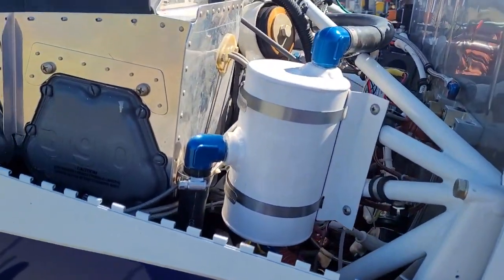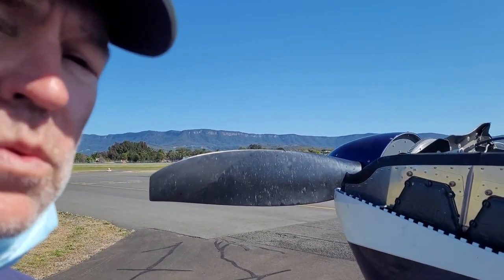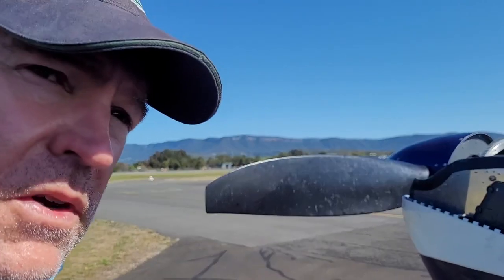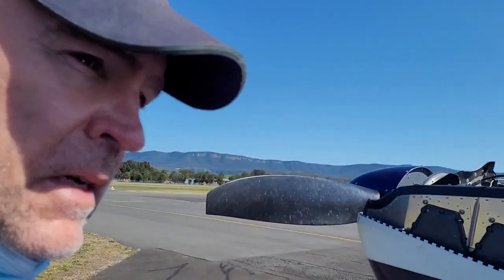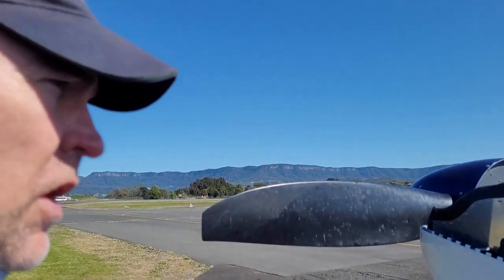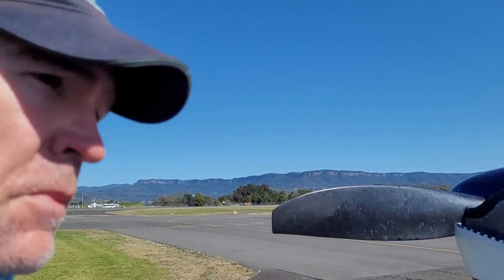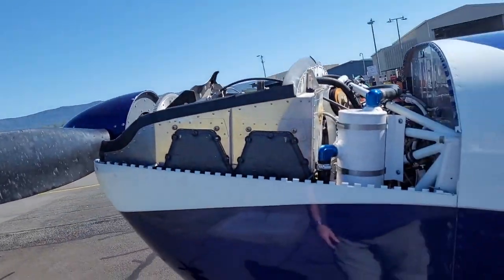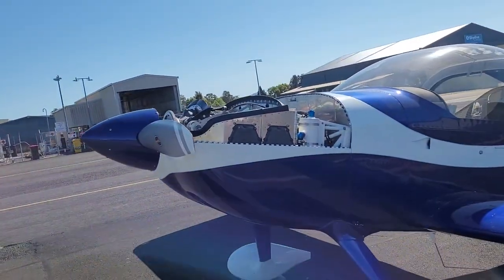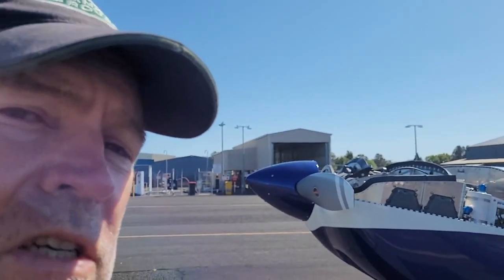I think we're just going to have to run the engine, see if we get any oil leaks, and hopefully be back in a few days. That fitting will capture the oil when we're inverted. It's only the half raven system — we can add to the full system later, which is not too difficult to do. For my sorts of aerobatics, I think that'll be adequate. We're going to test that to see how much oil leakage we get and reduce that. From a safety point of view, it also stops the engine shutting off if you go negative G by mistake — though that's not really the intention. We're more looking at zero G or maybe minus one just for a few seconds. So we're just going to start her up and see how she goes, and hopefully be back soon to do an actual test flight and get some G's going.